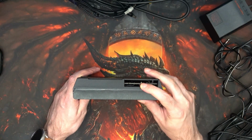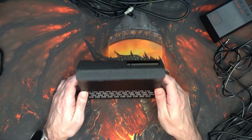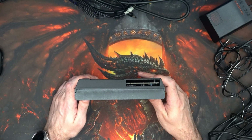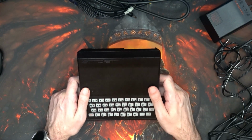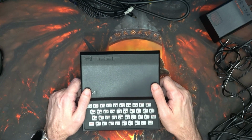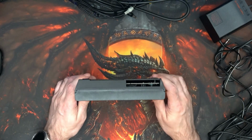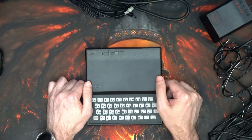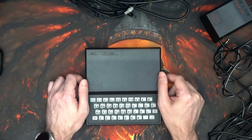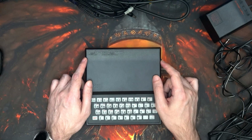We've got an expansion port, which doesn't really give you much chance to expand really. Well, not in the old days anyway. You could get 16K memory, 32K memory, and even 64K memory. And I seem to remember there was 128K kicking around at the time, but that was sort of rare. But the truth is that it was quite difficult to program for doing that, because you had to page blocks of memory in and out, and of course that takes memory to do, and the ZX81's not the fastest of computers, so there was very little that was especially written for such large sizes.